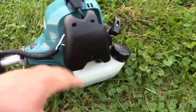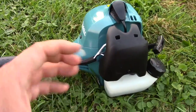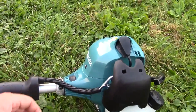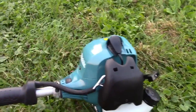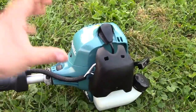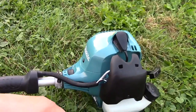The fuel tank is fairly large and seems to hold quite a bit of fuel. The recoil has a bit of an assist to it — there's spring tension inside — I'm not a big fan of that. This trimmer's engine actually has quite a bit of compression, which was somewhat surprising. I'm guessing there is a two-ringed piston in this machine — don't quote me on that, I haven't had the exhaust off to look — but judging by the compression and how the engine feels, there's a high possibility of a two-ringed piston.